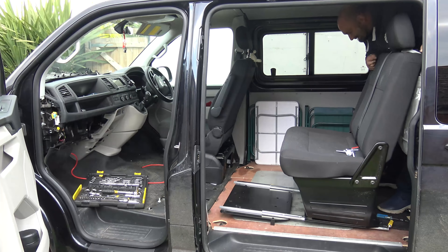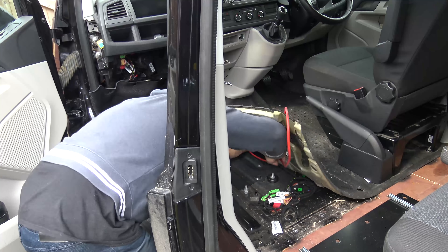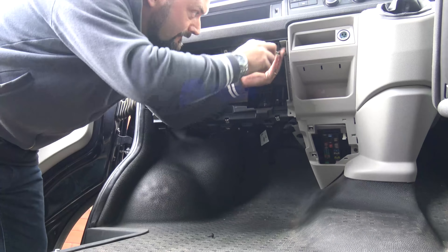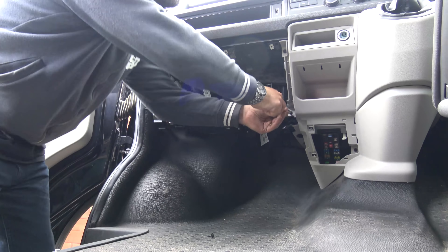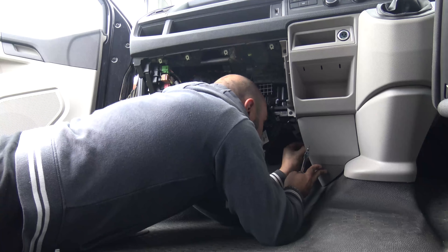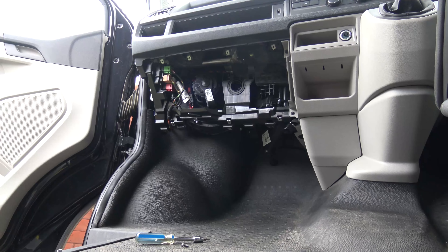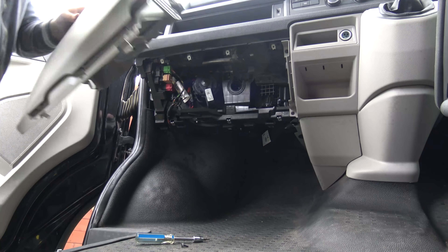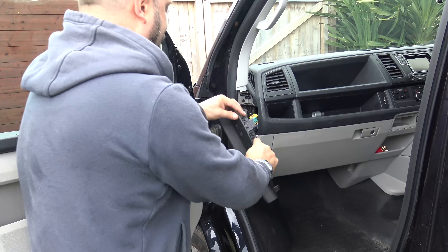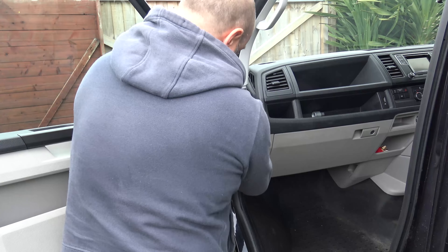It's relatively easy — not too hard a job to make this happen. It's a bit fiddly, but get that carpet out of the way and push the cable through the well there to the driver's seat. Then this is just reassembling the dashboard — I had to pull the whole dashboard apart, which was driving me crazy. Getting all those panels back in place, the glove box back in. It's like a T16 Torx driver or something like that. Don't forget the airbag connector — you want to make sure that switch is active. Slap that back in place.